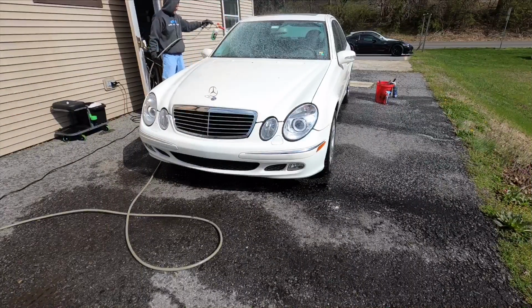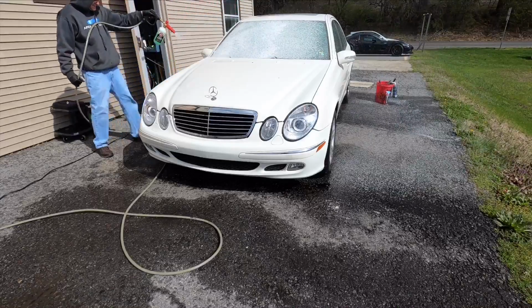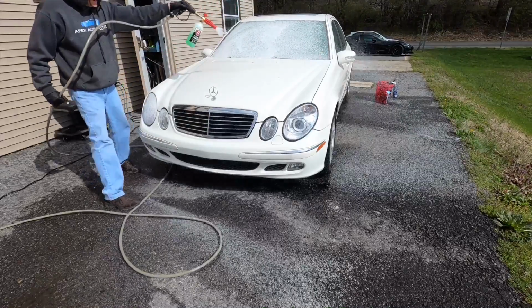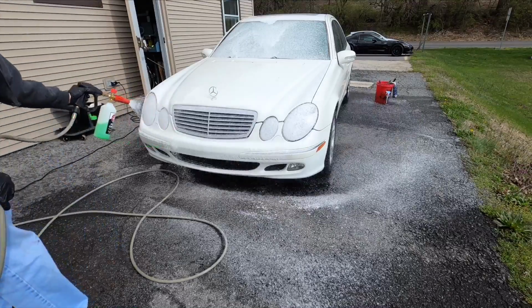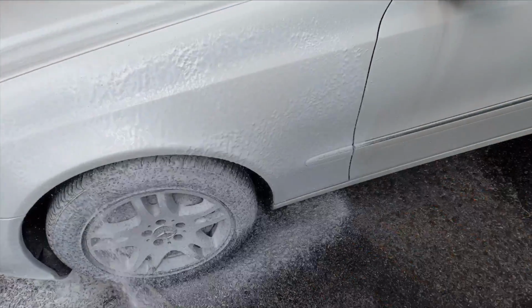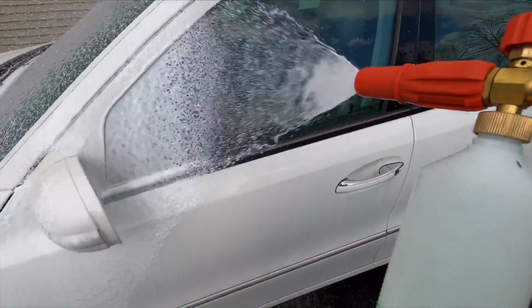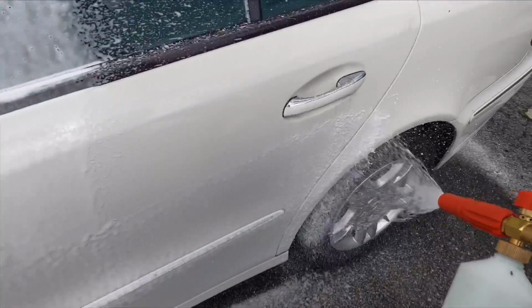For those just getting into detailing or who want to start taking care of their own car, where does the iron remover fit into the detailing regimen? Well, it's right after the wash. You want to do your pre-wash and your contact wash and remove as much as possible so the iron remover can make contact with the surface and the ferrous metal to start breaking them down. It can't do that if there's a heavy layer of dirt on the car first.